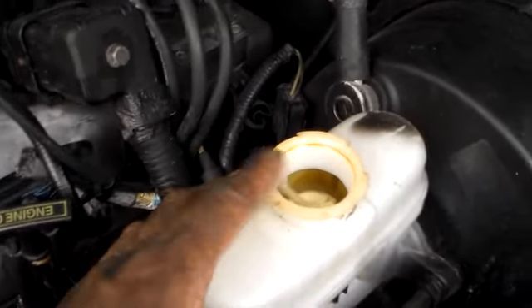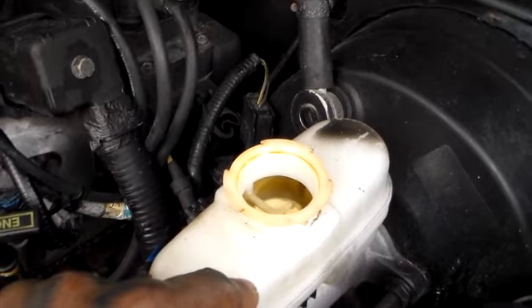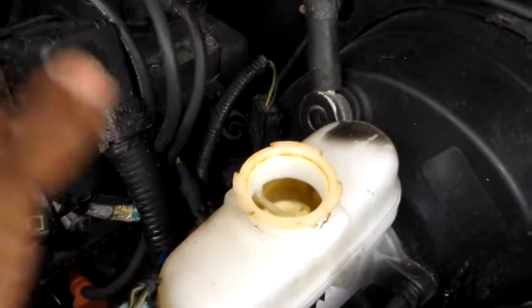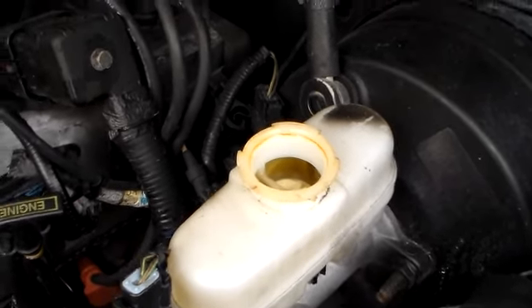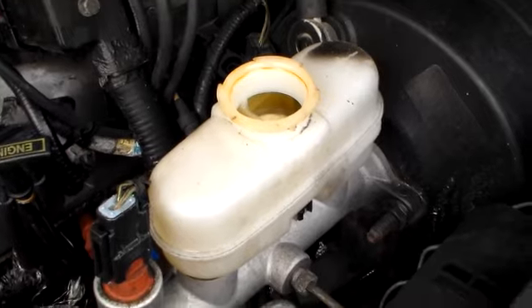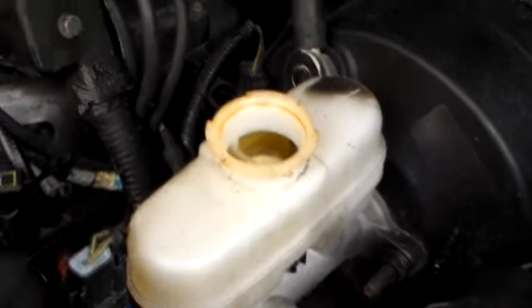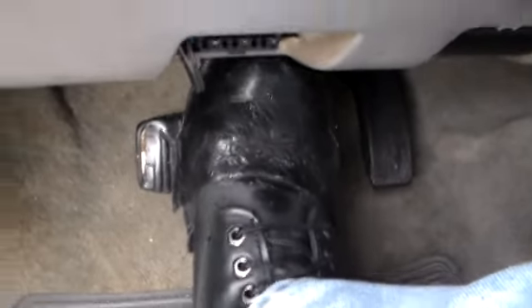That job is done. You can see my brake master cylinder brake fluid is clear now. My master cylinder is back up to where it's supposed to be, the level. I did all four lines in right under 30 minutes. You can do it yourself - this is cleaning your brake lines by yourself with a tool from Harbor Freight. Thanks for watching and don't forget to subscribe. Get all your lines cleared out, get your brake master cylinder filled back up. Go inside before you start it up and pump your brakes to get the pressure built back up. And you're good to go.